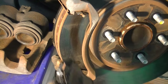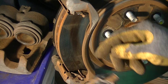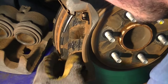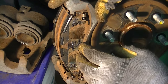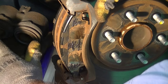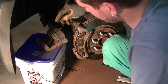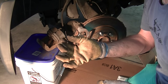Simply slide them in — you'll see an actual groove where the bottom and top of the pad sit, so slide them in and line it up. You'll hear a very definitive click once they're on. Now we just need to take this caliper, slide it back on, and get the screws put in place. Before putting the caliper back on, you need to get the little clip back in place.